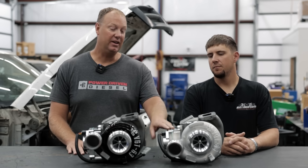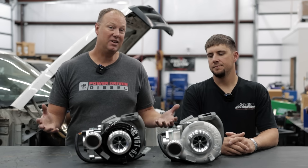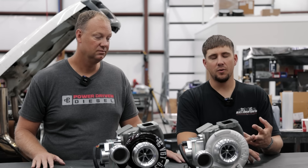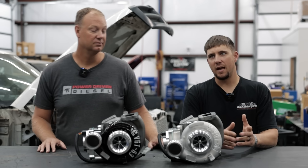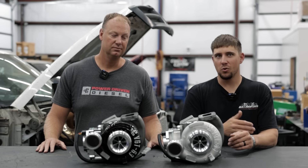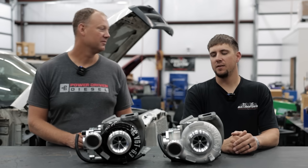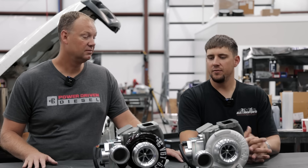It's kind of industry standard and I don't think it's worse than anybody else, but it kind of sucks. So we decided to go with the Billet City Diesel Actuator — we actually partnered with them and these are their actuators that we're putting on our turbos. They tend not to fail. I have eight or nine thousand miles on my turbo. We tow my 53-foot enclosed race trailer. We go over I-70 through Denver, Vail Pass, Eisenhower Pass. Anytime I come up to visit Power Driven I go over the grades out of California into Nevada and climb from St. George all the way to Cedar. I've been very impressed with the drivability at elevation, and the EGT control I have with this turbo.